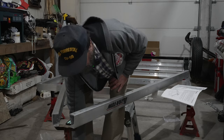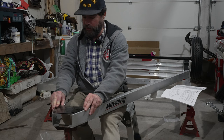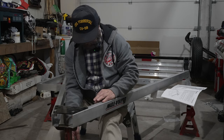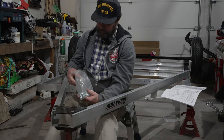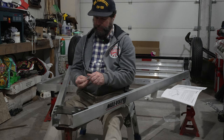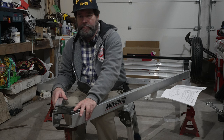Now I have the bottom plate. The bottom plate is going to go right here, so we've got to line up all these holes and put nuts and bolts in them. You don't want to tighten all these up yet because according to the instructions you're supposed to have it a little loose so when we turn the trailer over to do step 5 we can make all the final adjustments on this part of the trailer.